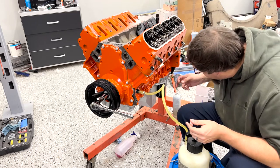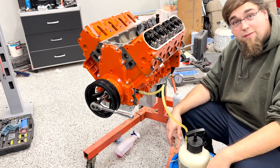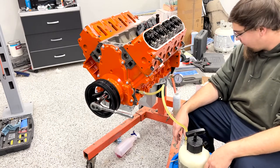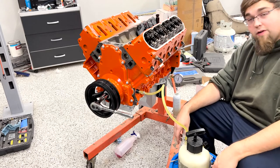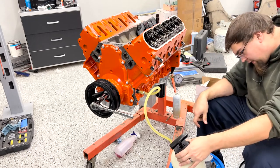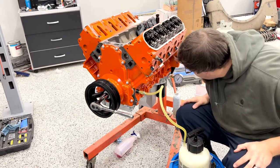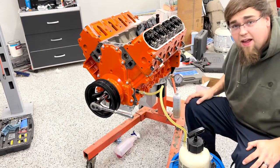just the size of the oiling system and how much it consumes. Yeah, we are finally getting pressure here on the gauge. Maybe we were just still feeling the oil filter that whole time? That's what I was wondering, if maybe you weren't going to see pressure until the oil filter was filled. I mean, we've used probably over a quart already. This bottle is exactly 25. We're seeing about 18 and a half here.